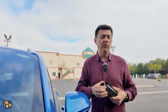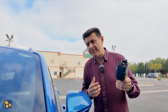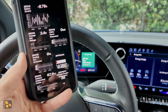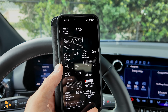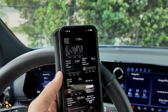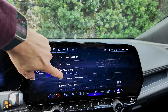It's about 60 degrees outside, overcast, so thermal load from outside isn't a big problem — cooling is the issue I could foresee. Vehicle status: we're at 11% state of charge, and from our data log we're at 3.4 volts per cell, which means the pack is just barely over 270 volts — solidly under 300 volts. We're consuming a little power because the heater is on.